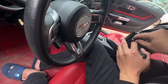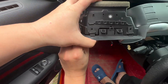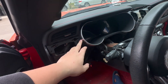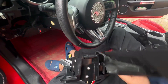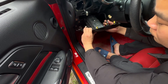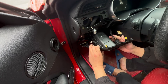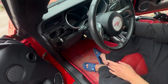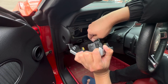Install the new panel — you can see it's perfect. When you're finished, start the car to test if the digital cluster works normally, then you can put all parts back. You also need this part. Now we've installed the digital cluster — install your factory fans back and plug them in, then plug in your factory plug.